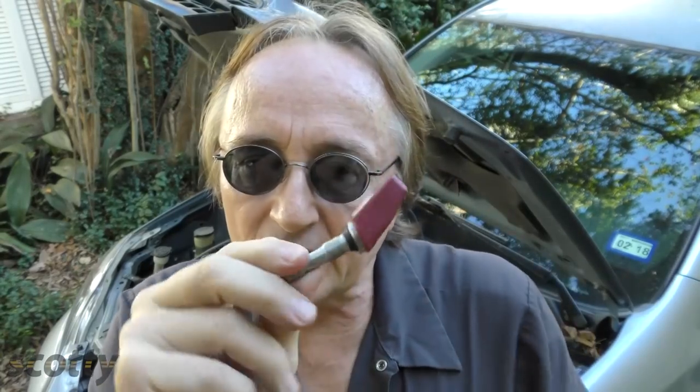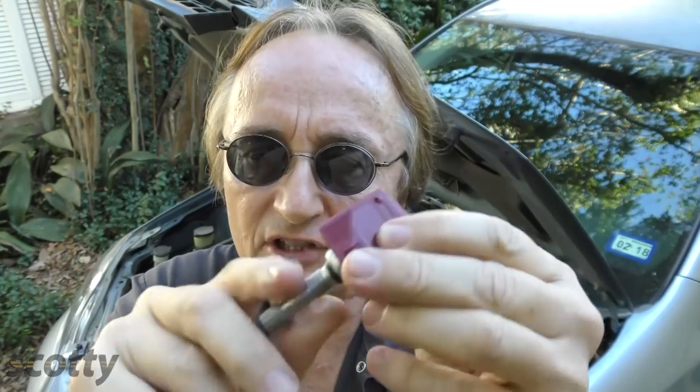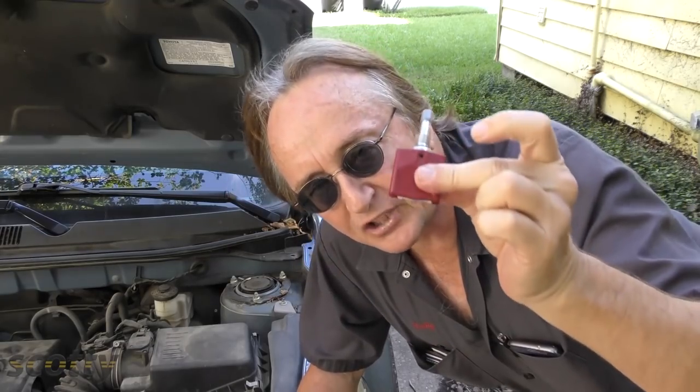But these systems have one big drawback. The sending unit inside the tire has a battery inside — it's not replaceable, and even if it was, you'd have to take the tire apart, replace it, put the tire back on, and rebalance it. As we all know, batteries have a limited lifespan. When all four go bad, you can spend five or six hundred bucks. You can't take your own tire apart — it's got to be a mechanic with a tire machine, then he's got to rebalance it, then reprogram the computer to accept the new sensors.